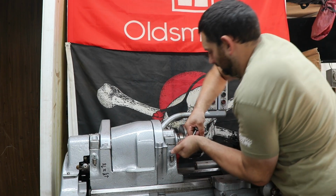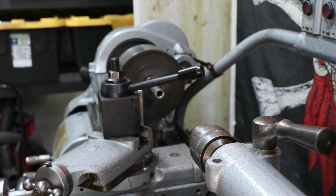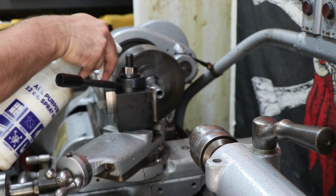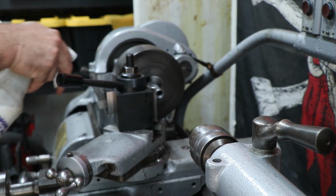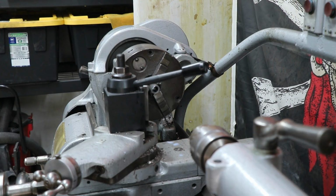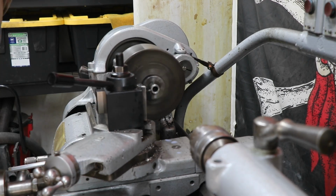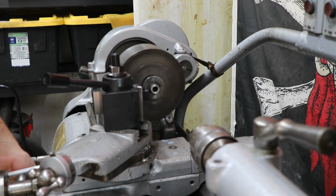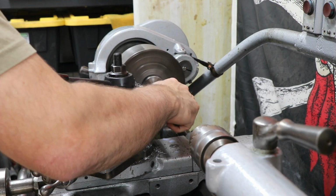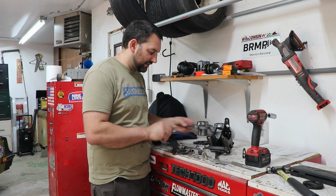Fix that. I've got this piece of steering shaft tube. It's 3/4 OD, 1/2 inch through the center, so it slips over the bolt nice and easy. And I'm going to cut the length that I need to remove all of these 4 washers and a spacer. I'm just going to cut a single piece out of this because I'm going to put it all to one side, and then we'll just weld that sucker right on, and then this entire section will be supporting the load instead of just the narrow point of the clutch pedal itself.